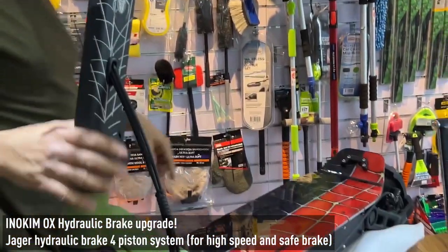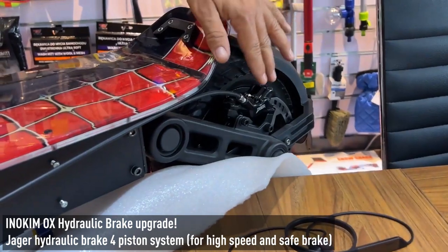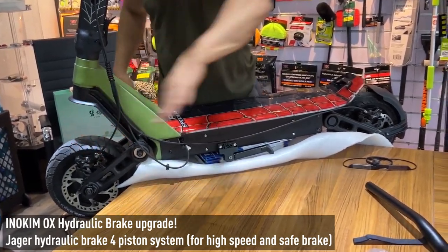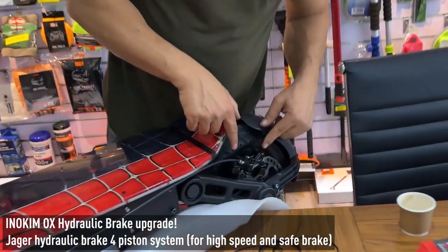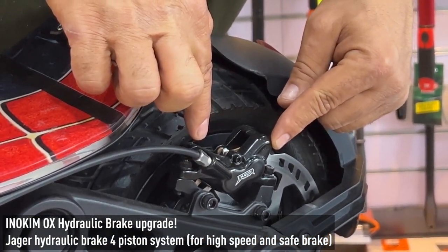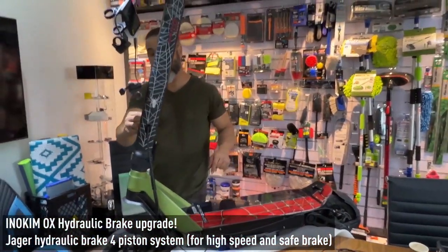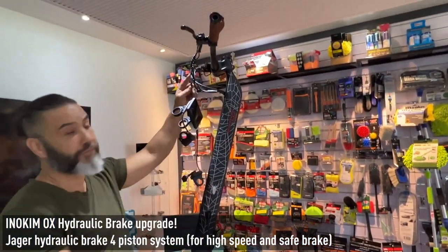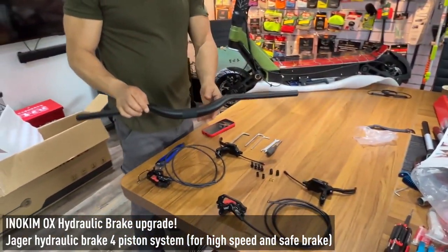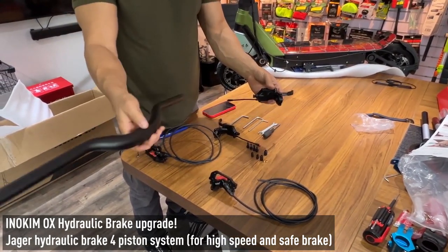If I go from the back, it's a different caliper — it's called mirror. This is front and this is back. It looks the same but it's like in the mirror, because when you take it from here, it's moving like this — this is the direction. So the same thing I do here: open these two screws, position the caliper in place, move the pipe according to the same position as the regular one, and it goes up to the left side. Now I put the stem here so it would be more convenient to see. We have the right side and the left side.